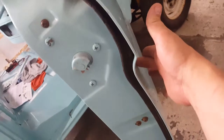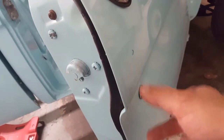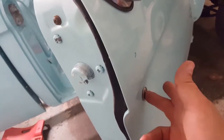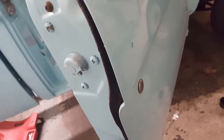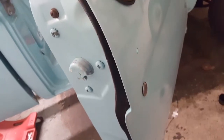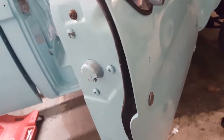The doors lock now. I got the lock hooks sorted between the key on the outside and the door bar. There's a rod that has to catch between those two to turn and unlock. On the replacement lock cylinders I ordered, the keeper didn't have a way to keep that rod clicked into place. CJ's Pony Parts — a Mustang supplier — has those clip ends from Mustangs of the same era; it's the same part. I didn't find it on Dennis Carpenter or LMC, but CJ's Pony Parts has it and it works perfectly.